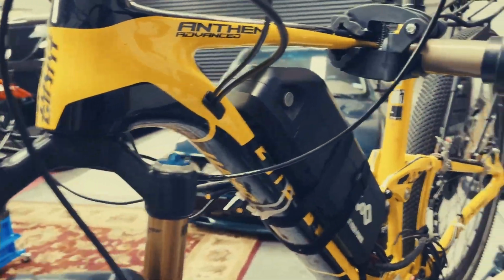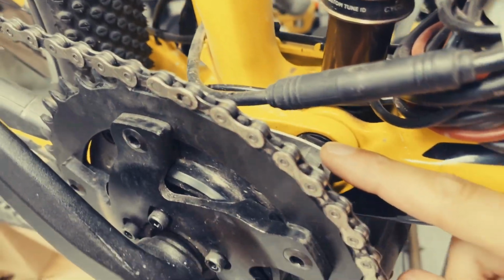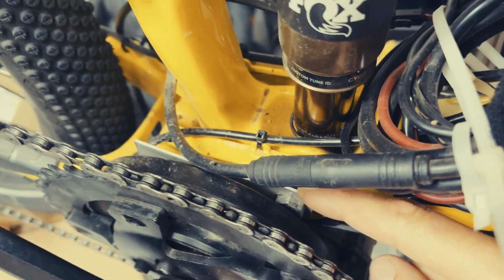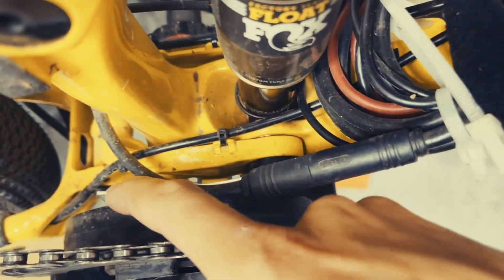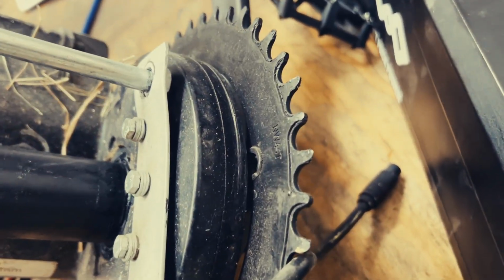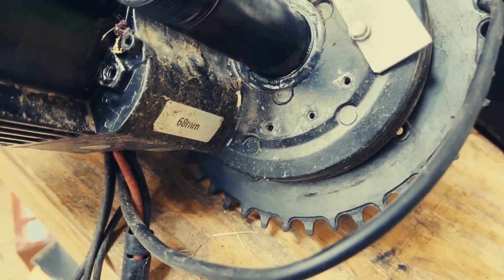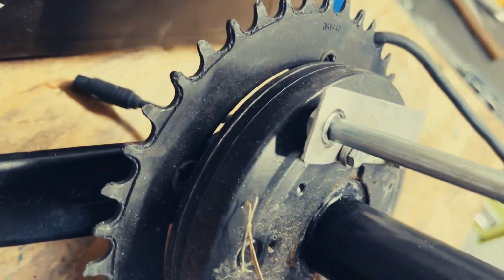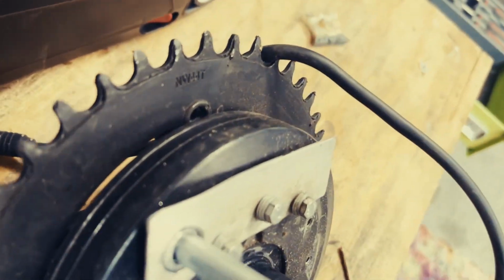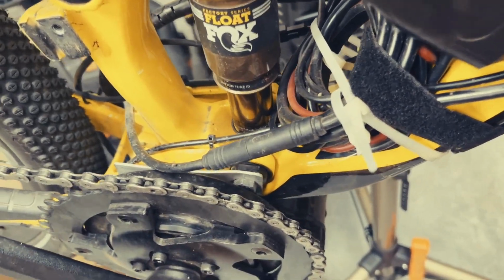So essentially what I've done is I've added on the other side this piece of aluminum, which then bolts into the holes that go on the side of the actual motor. They're very hard to see. I'll throw in another shot here that shows them. But essentially I have Loctited a few very small bolts with washers into the actual motor, and then I've routed it through this bottom shock bracket point so the rear shock will still work.